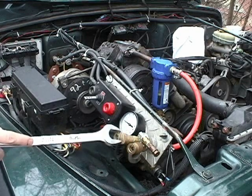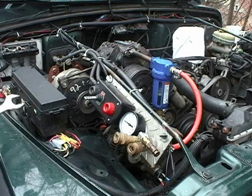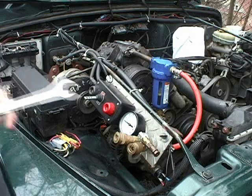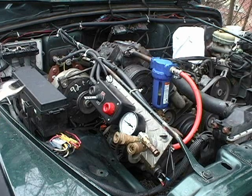If it gets below 110 PSI, it turns the system back on, recharging it. If it goes to 145 PSI, it turns it off before the system becomes dangerous. From here, we see two quick disconnects: an industrial for my air tools and a universal for friends who use automotive or manufacturing type air fittings on their air hoses. From there, we see a 180 PSI panel mount gauge. Right next to this, we see a small control box.